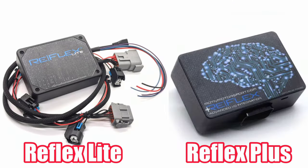Starting off with Motive Reflex, there are two different versions: a Reflex Lite and a Reflex Plus. The Reflex Lite is a simple port injection controller — all it does is control your port injectors, fires them sequentially, and gives you the additional fuel from the extra six injectors on your manifold. If you get a Reflex Plus, it adds a lot more capability by adding several other outputs. You can control things like your boost pressure if you have an externally wastegated turbo setup, nitrous, meth injection, and a low-pressure fuel pump.